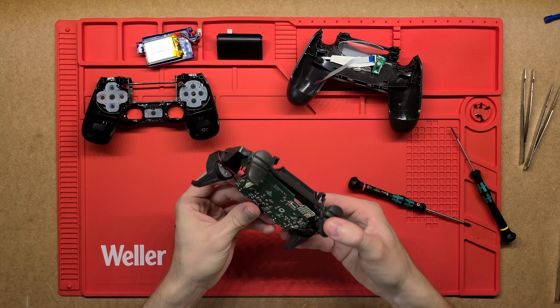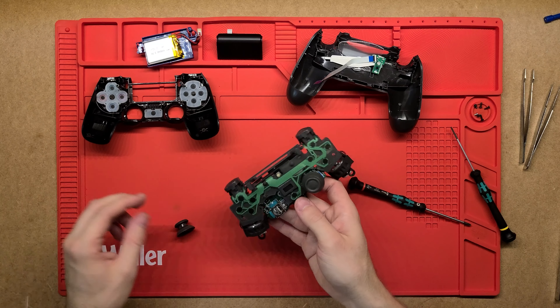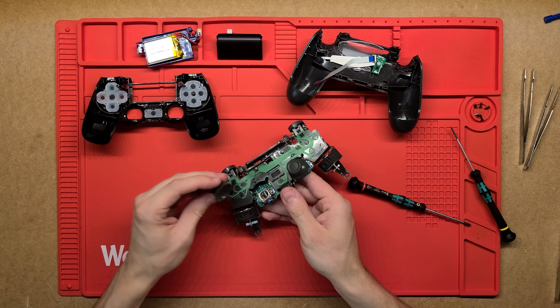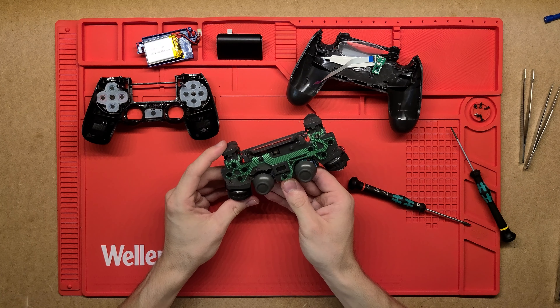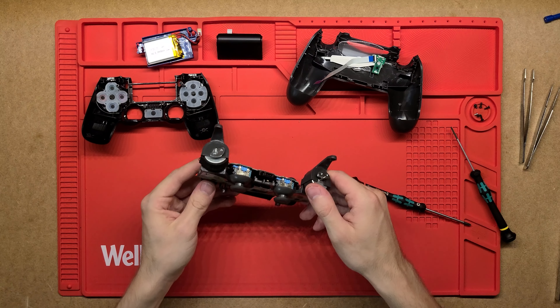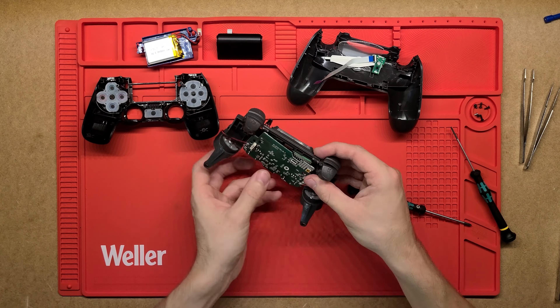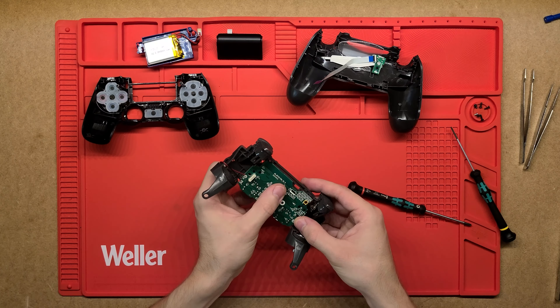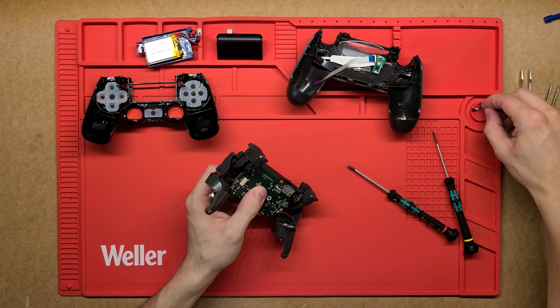On this side there are a couple of voltage regulators, some small chips, and then what's probably a big microcontroller chip doing most of the work. It's close to the antenna — this is Bluetooth protocol — so there's a crystal oscillator that determines the frequency for the chip, and then it gets transmitted out through the antenna.